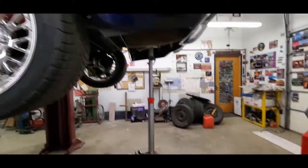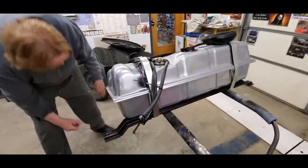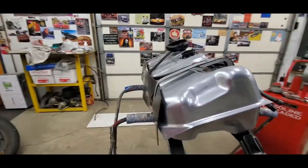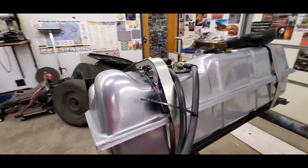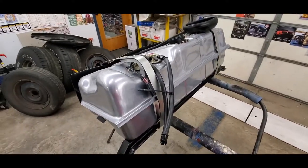So, cracking lines, letting that drain. We've pulled about as much out of the tank as we can. So, yay, this will be fun. Well, that was fun. We got her down. We didn't make, you know, too big of a mess. Let you see, it's a tight cavity. But these things are razor blades. So one thing I think I'm going to start doing on my tanks is taking things like this and softening them down before they go in the car. That's the first time I got bit by one of those.